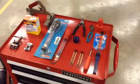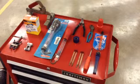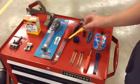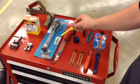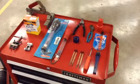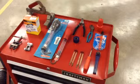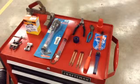But anyhow, let's take a look at some of the tools that we have available for us when we service batteries. Of course, we have the hydrometers, and we've talked about those a little bit in earlier lessons. We don't want to confuse those with coolant hydrometers. And of course, batteries now are maintenance-free, so they're sealed, and we really can't get inside of them to check electrolyte anyhow. So we can, though, look at the indicator on the battery, which is going to show up as like a green dot, okay, a little sight glass, and we'll talk about that in a later video.